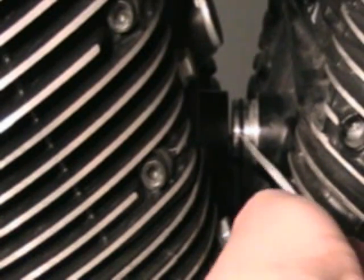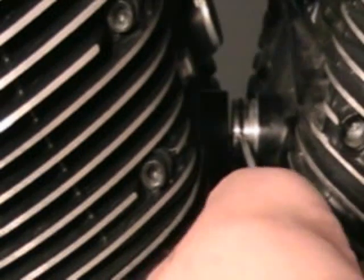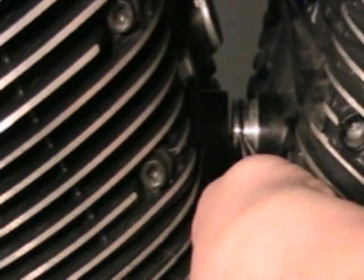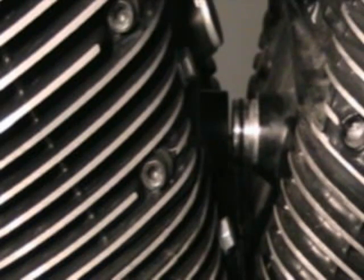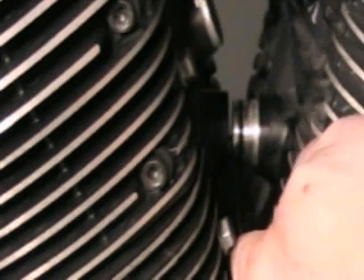I've got the O-ring on this side now. I'm going to separate my floss so I can pull one side. That antifreeze gets on it and likes to stick together. Slide that out real easy so you don't dislodge that O-ring. And there you go — that's one O-ring replaced.